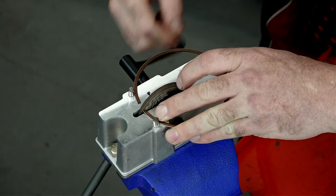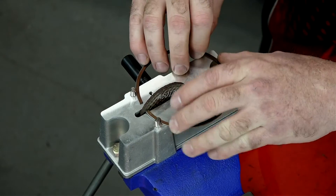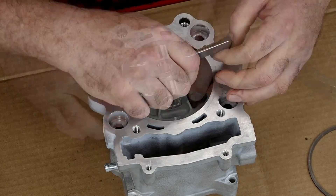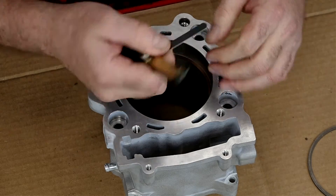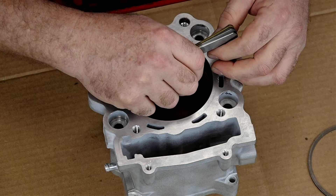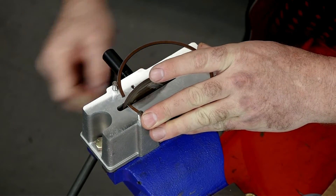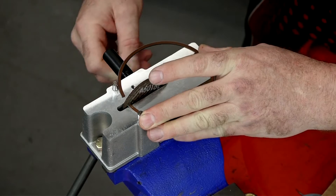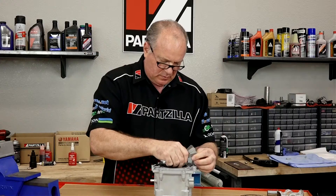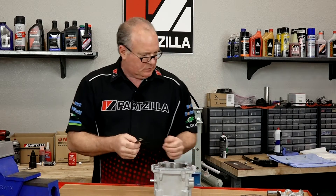This is where patience pays off great dividends. You get this right, the engine is going to seal up like it's supposed to and have plenty of room for those rings to expand. Let's see where we are: 15 is in. That still may need a little bit more. 16 will go but it's a little too tight, so let's go a little bit further. 16 goes, 17 goes, 18 does not — so that's where I want it to be.